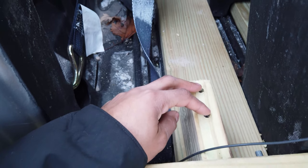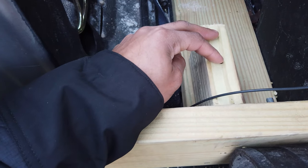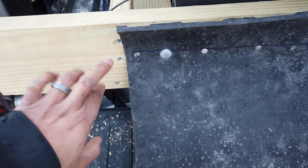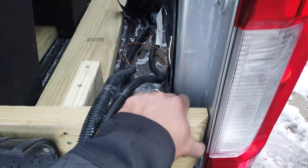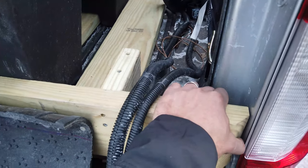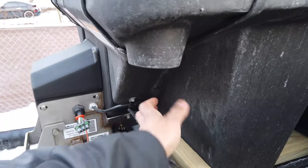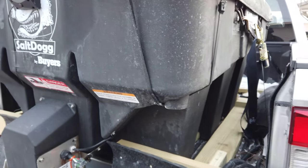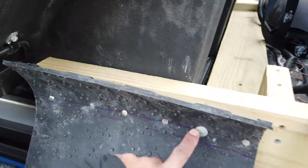I reinforced the wood — I didn't want it to be loose or compromised in any way since it's holding all this weight. I took a two-by-four, pre-drilled, and sunk two screws down in there, then took two more screws going the other way. So it's really solid — can't get it to flex at all. The salt spreader is now wedged in real nice and tight, so even if the straps ever came loose, which is pretty unlikely, the spreader itself can't fly out or slide out.